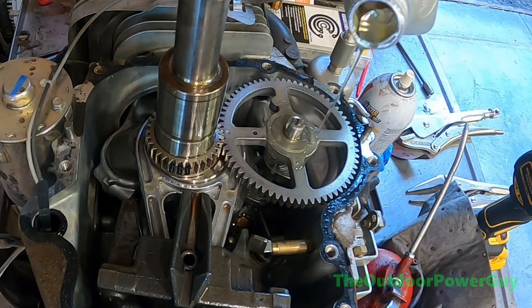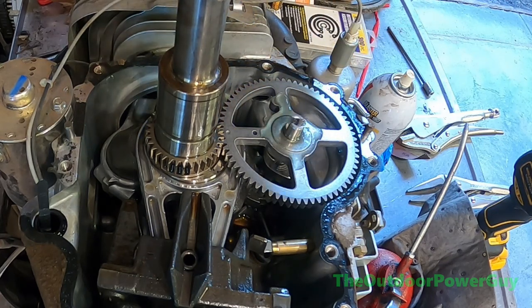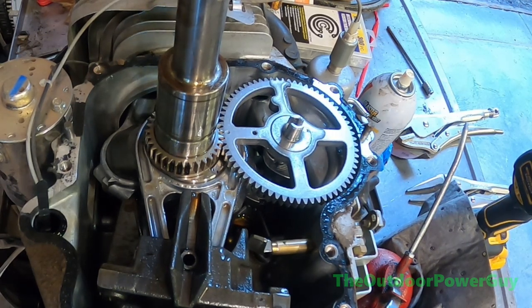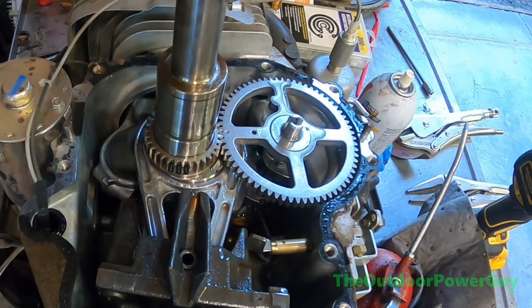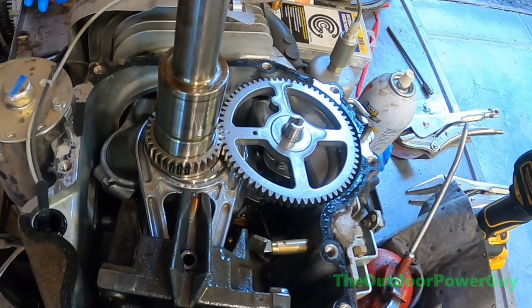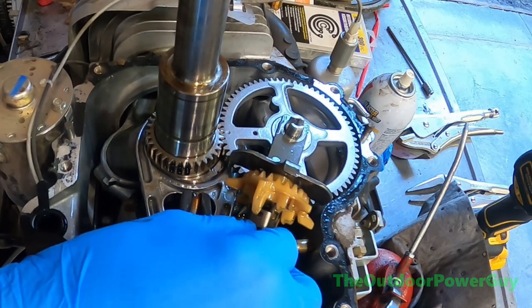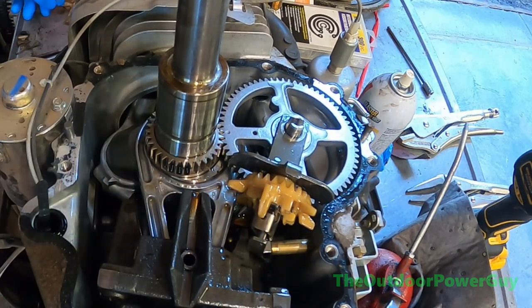Never dry fit parts. I'm using leftover 30-weight standard small engine oil, which is always on the table because lately I've been doing a lot of engine internals. In just one week I've done four or five of these Briggs cams — it's crazy how these fly apart, and it can be an engine that's two years old or fifteen years old; there's no telling why it breaks. Always make sure that your governor gear is in line with the governor arm, because otherwise it'll slip off and your engine will run wide open and you'll be pulling it apart again.